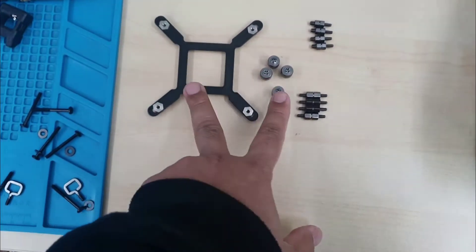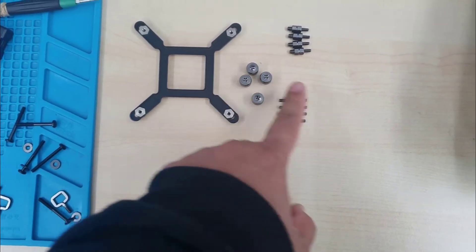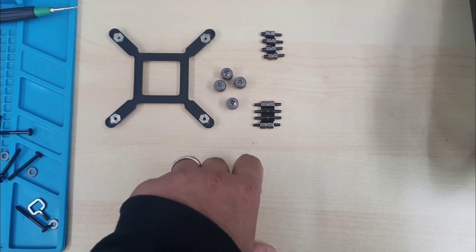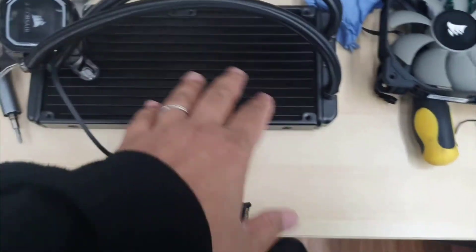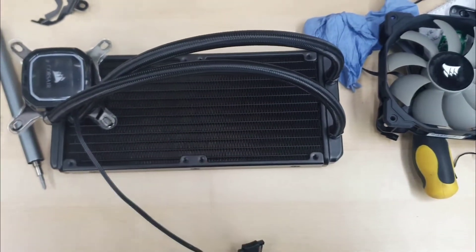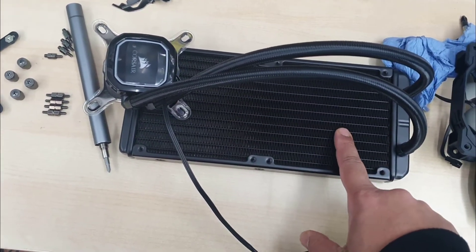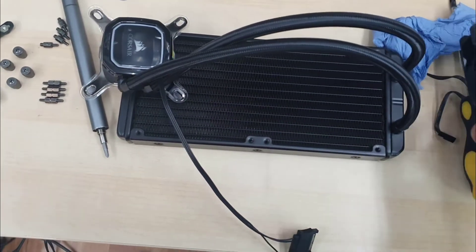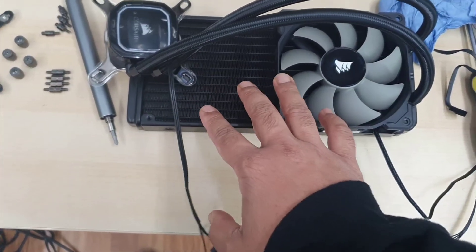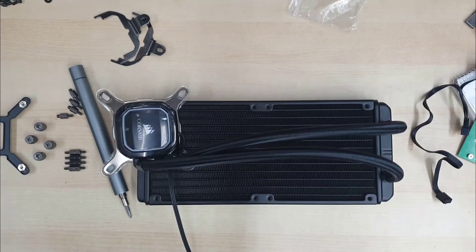If your board is Intel, you need all these screws to hang the bracket on. Make sure you keep them and double check that all four of each type are included. The actual pump comes with a plastic cover — until you finish the fan installation, please don't remove it, because the thermal paste would get damaged and spread everywhere. The correct way to install the fan: the cable has to face down and the Corsair logo has to face up. That's the standard for almost any brand.